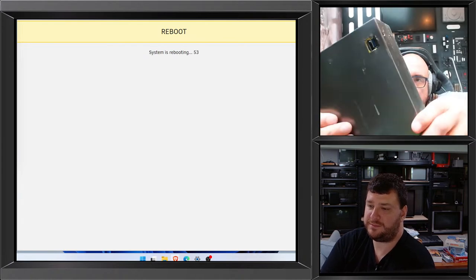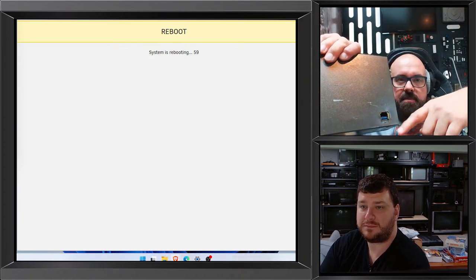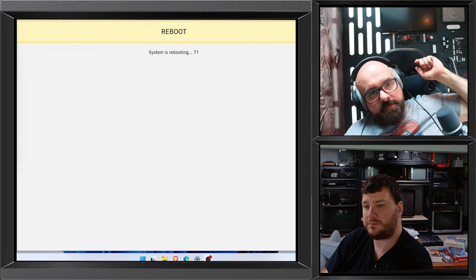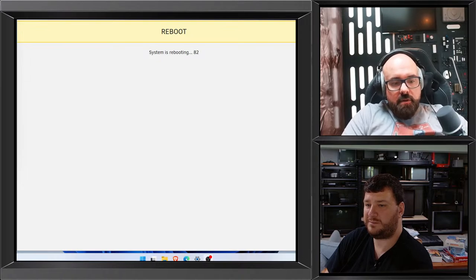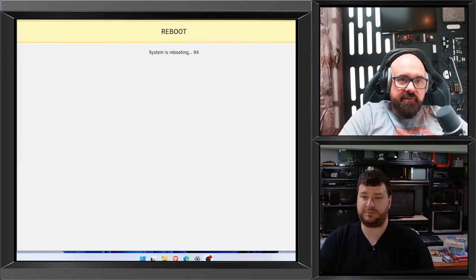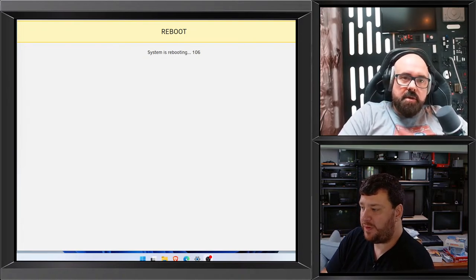I put it in this case thingy here, and there's a little adapter you can buy on Amazon. It's about $20, and it's just a PCIe to PCI adapter that has two ports. You plug a USB cable into this bit here, then it plugs into the adapter. It's a bit like the risers you use for mining rigs. And then you can actually pass through the old PCI devices. So for Windows 98 or Windows 95, you can just emulate a Pentium CPU and then pass through a real GPU. It works really well for me. So you actually get a real Sound Blaster and a proper graphics card. Before the Voodoo 3, I was using a Cirrus Logic card, and that worked pretty well. They're a bit cheaper.